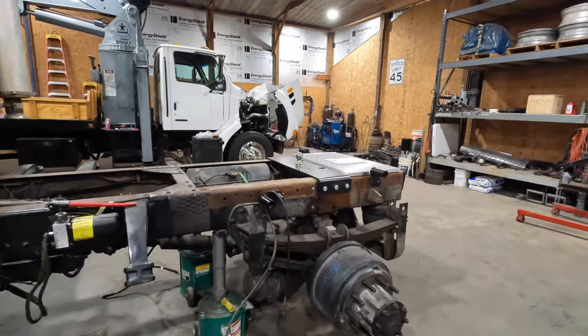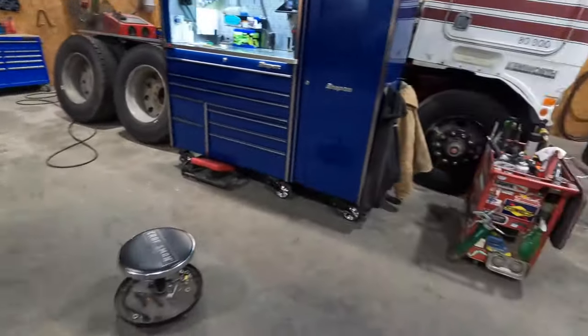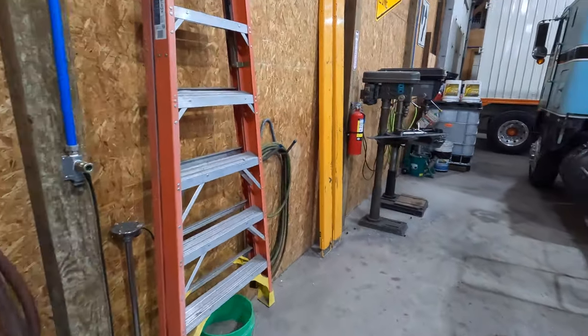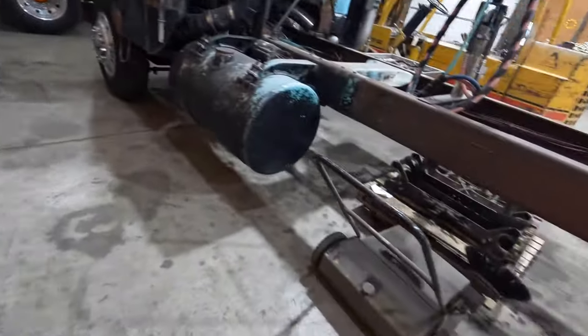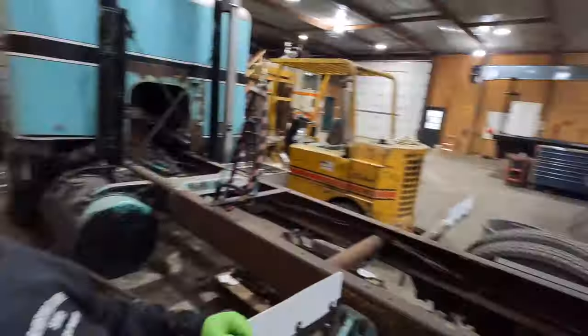We got the steel in to take up this space up here in the goose mount. Just got a small piece of it. Got her marked off at 10 inches here. Got a mark scribed. I'll cut this, do another one, scribe it, and then put it over there, fit them up, square them up, mark the holes. Drill the holes, and then we'll get them in there, get them tight. That'll be mocked up. We know that will be good for later on when we do assembly after it's been blasted and painted. So I'm gonna throw you guys on time lapse and get that knocked out.